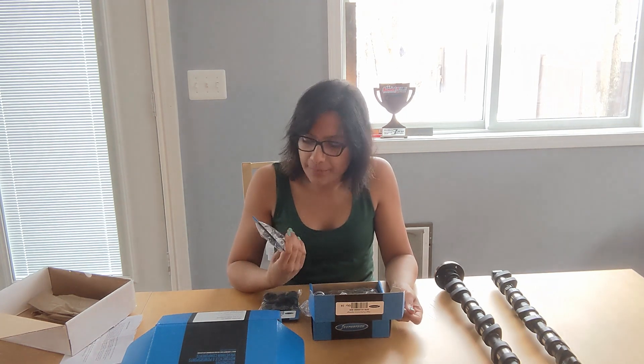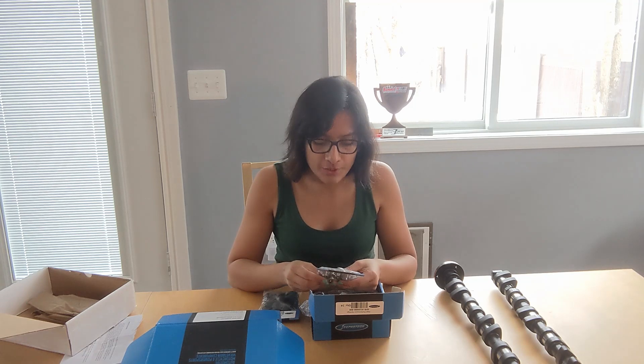These are dual spring kits. They're stiffer, and because of that they prevent the valves from floating and destroying the engine. We decided to upgrade our retainers as well to these high performance ones, so we don't crack the OEM retainers under the high stresses.